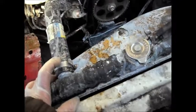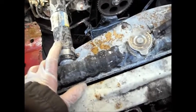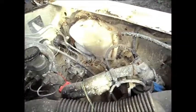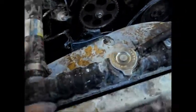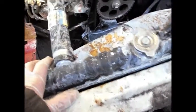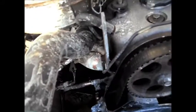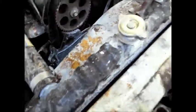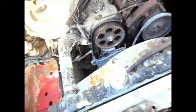I refilled with water, then let it run until it was mid-temperature. That's when the overflow tank started bubbling. Now it's cooled down. I also took the thermostat out — there's no thermostat in there. I'm leaving the thermostat out, which requires letting it idle a little bit longer when you take off in the mornings. I left the thermostat out so the water will circulate more freely — just as a temporary fix. It's all temporary in my world.